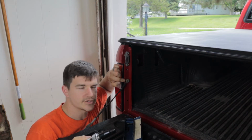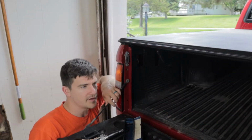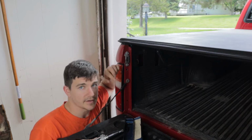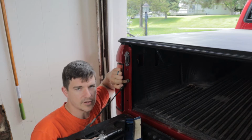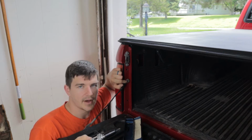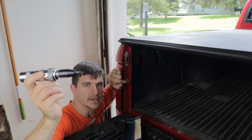This truck has two big Phillips head bolts, and that's the only thing that holds these cables in. But they're a huge pain. This truck has spent most of its life in the Northeast. It's very rusty, so you can't just put a Phillips head screwdriver there and expect it to come out. So they have these tools called impact drivers, which is going to be the savior of today.